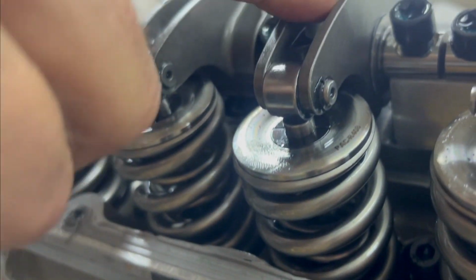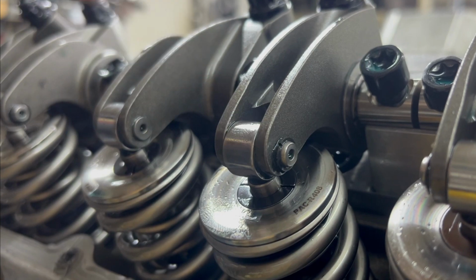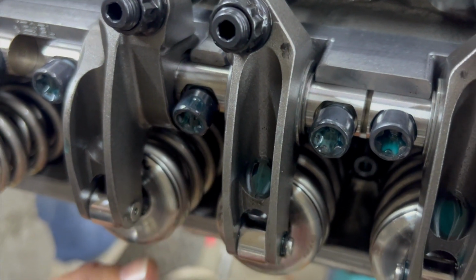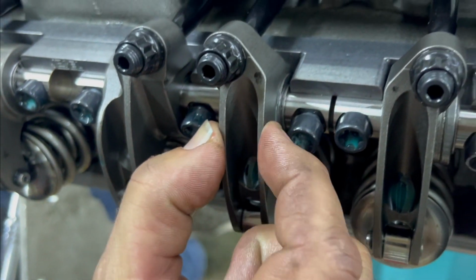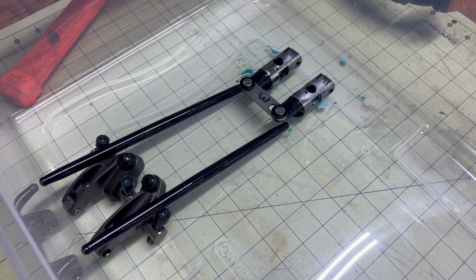So here's your valve inside the spring, and the weight of the rocker out here is what's key. If you look down in here, bring your camera up here and look down in this view, see where there's cut out? It's a very lightweight rocker, even though it's steel over the valve. So that moment of inertia is much easier to control. Whereas back here in the bulk of the strength of it and above the push rod, that weight doesn't matter near as much. So the push rods are getting numbered, I see.